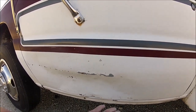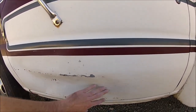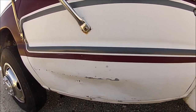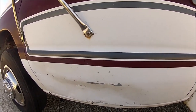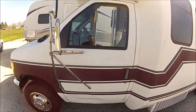This was the only spot I was able to get it actually stuck, and even then it wasn't sticking too good because some air is still getting out and when you pull it real hard it just releases. So I think what I'm going to do is just sand it out, put a little bit of bondo on it to smooth it out, leave the dent in, smooth it out, and then just paint it. Eventually I may get another door for it, but we'll see how it looks.